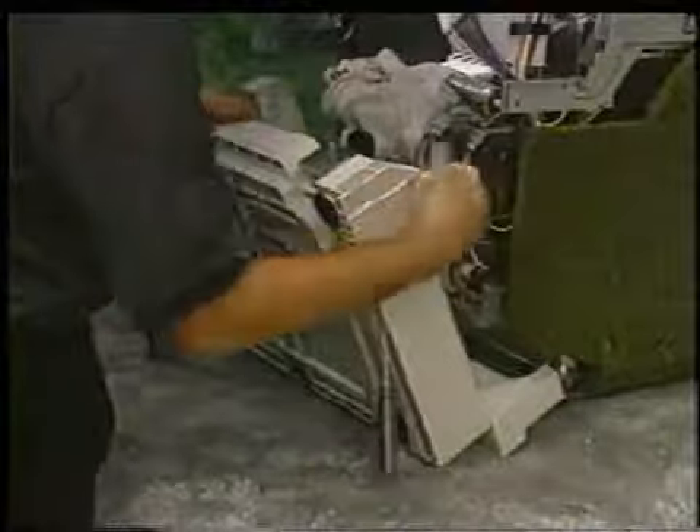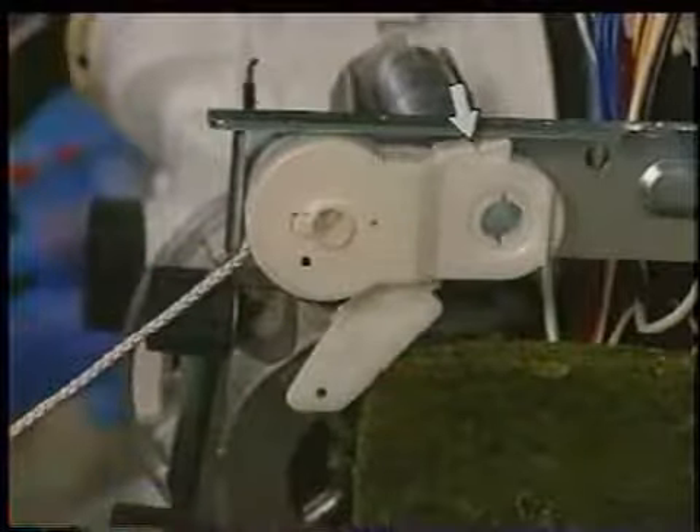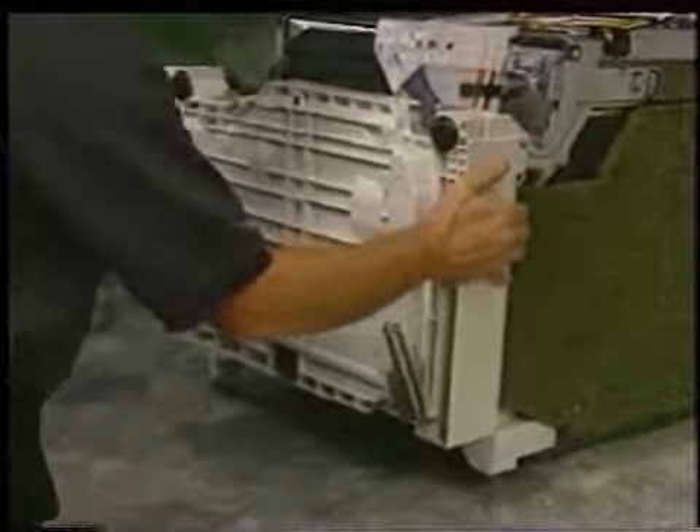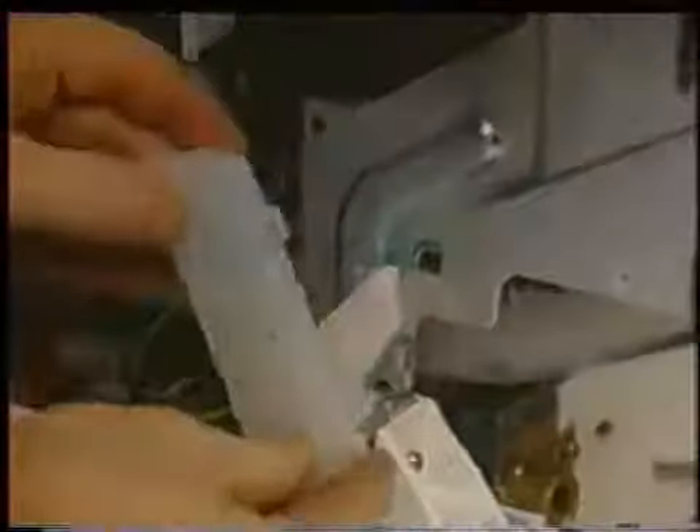To reattach the base assembly to the tank, bring the base up and attach the left and right hinge reels. Insert the hinge reel key into the frame cutout and twist counterclockwise into position. Note that the hinge reel has a bumper that faces forward when the reel is replaced. Now bring the base into position and onto the frame, making sure the circulation motor, sump, and the sump drain hose seat properly back into the base. Attach the left and right hinge pulleys to the hinge arms and then slide both door springs back into place along the bottom of the base. With the dishwasher back in an upright position, insert the electrical lines back through the electrical box and attach the electrical box ground wire, drain motor wiring leads, and reinstall the sump fill hose. Then reinsert the two wiring connectors back into the base. Install the right and left hinge covers, side panels and trim strips. Now reinstall the two rear and the four front base mounting screws.